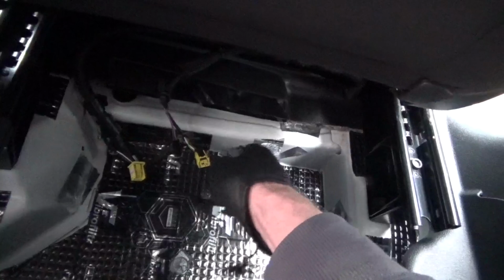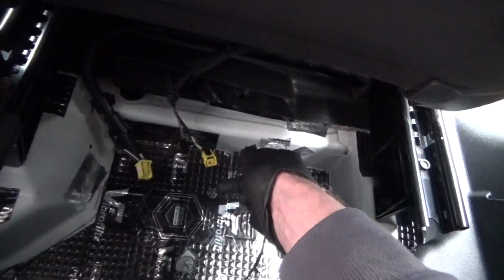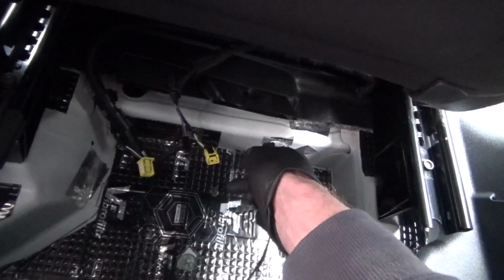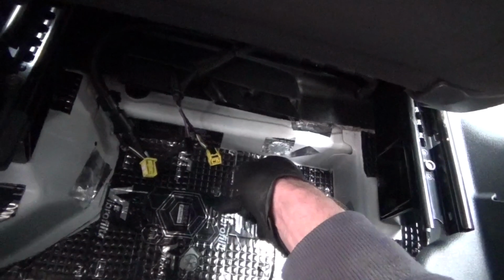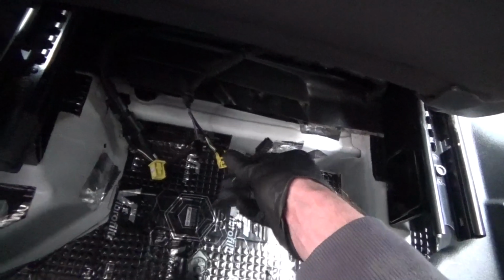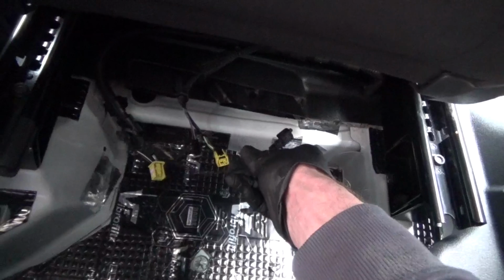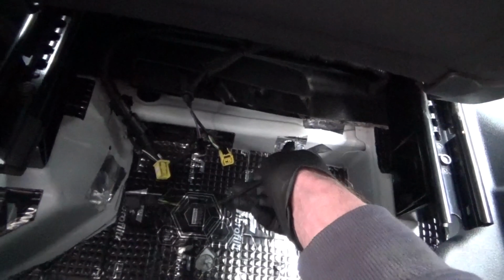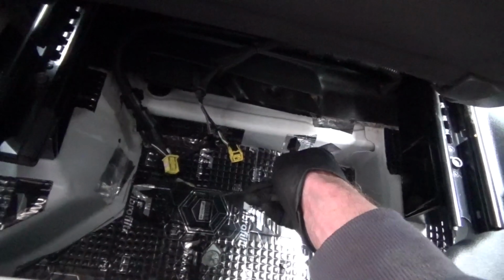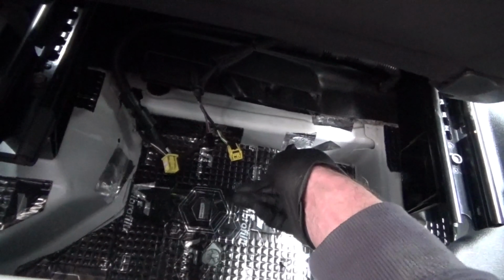And obviously when you're doing this seat swap, just leave your ignition off all the time. Don't put your ignition on when you're doing anything, just in case you get your airbag light, and then you have to get it erased if the light's on the dash. So you have to get that turned off with the airbag light if you put your ignition on any time. So it's better to leave it off until you've plugged everything back together before you start the vehicle up.